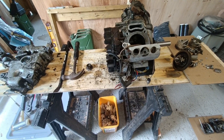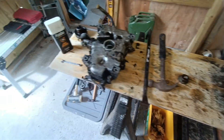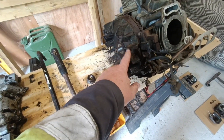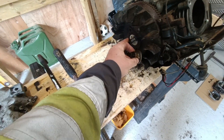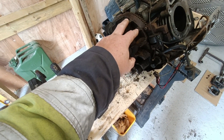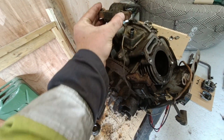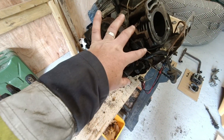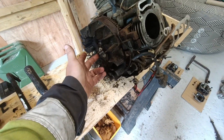It's been a few weeks since I last came and looked at this — I've been working. But I'm on my days off so let's have another look at it. I'm in the process of taking the flywheel off so I can actually get the crank out. It's a 30mm nut that goes onto the end here. Once I get it free, I've got to get it past these — I can't remember what these are, they're all part of the starting system. There's two 7mm bolts that hold them in, so they're going to come off in order for me to take the flywheel out.